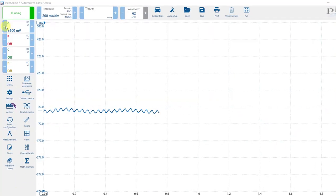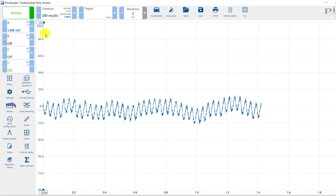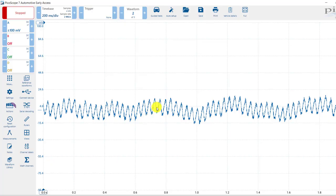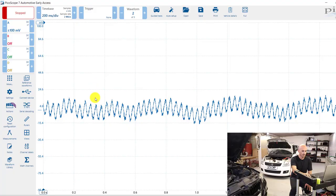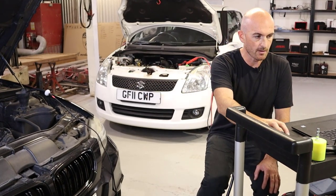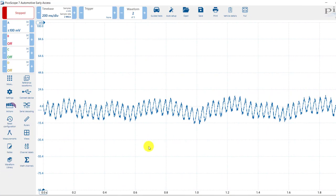I'm just going to bring the voltage down a bit. I'm going to stop it there and turn the engine off. Okay so we've got some test results here now. If we just scroll back through here we can see these are the pulses that we're looking at. This is a fine engine — there's nothing wrong with it as far as I know — and what we're looking at here is the pulses that are being picked up inside the expansion tank. The idea is that if you had a cylinder head gasket problem on the power stroke of the faulty cylinder with the broken gasket, you would see a spike in the pulse.